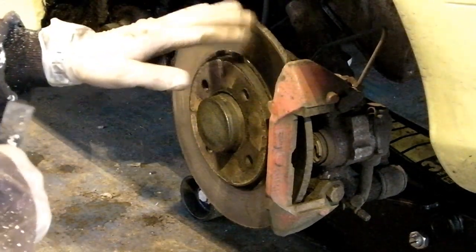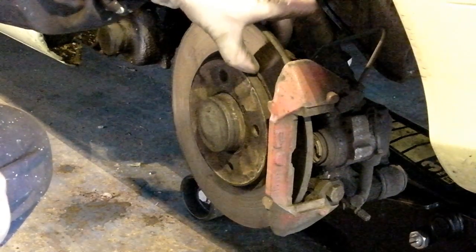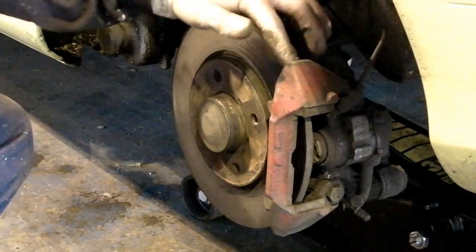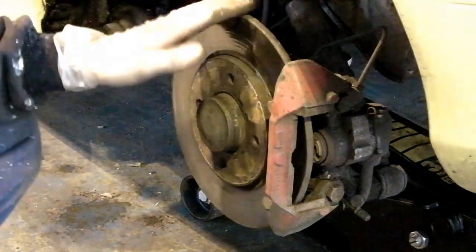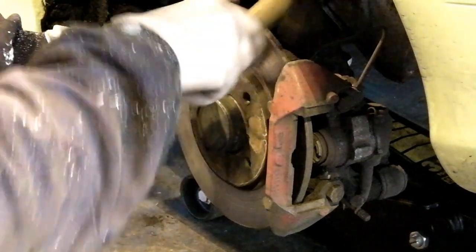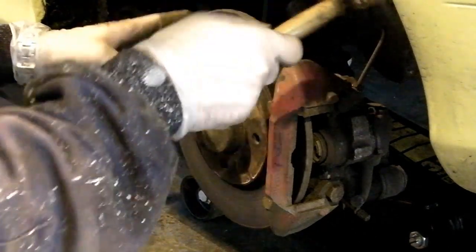What I'm doing here is something I always do when I check and change brake pads. The outer surface that doesn't contact the pad always gets a small portion at the bottom and a portion at the top that doesn't contact the pads — just a little ring around the edge on the actual outer portion. It corrodes and you get flakes of rust. If you leave these, eventually they'll flake away and can get stuck in places — at worst cause problems, at best be annoying with scraping noises. So take a hammer and work your way around gently — not a sledgehammer, a small hammer will do fine. Just work your way around, tapping away, and all your loose rust will flake off.